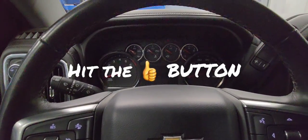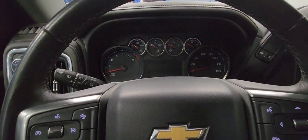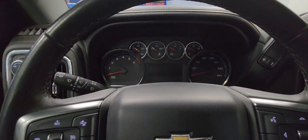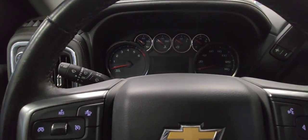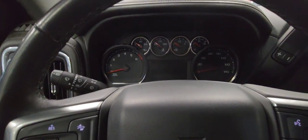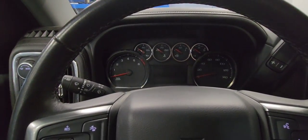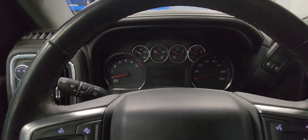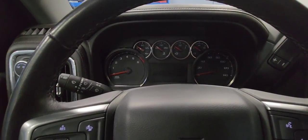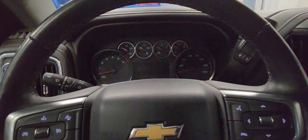In case you guys didn't know, those new trucks have what we call electronic parking brakes. You have an electric motor that actuates it, so whenever you engage your parking brake, the electric motor will hold it in place, right? So before you replace the wheel brake pads and rotors, you need to put it in service mode. You can't compress the caliper. Don't even attempt to do it without doing that procedure, okay? Without putting it in service mode. So I'm gonna show you how to do it.